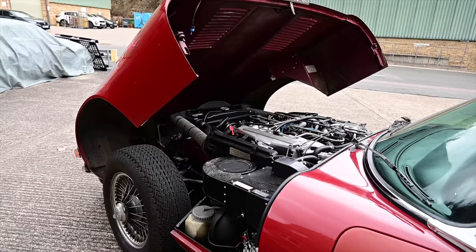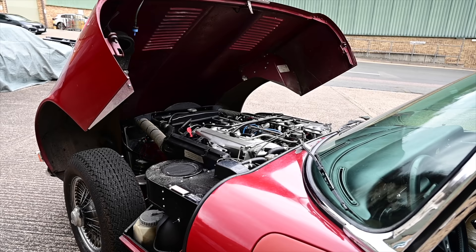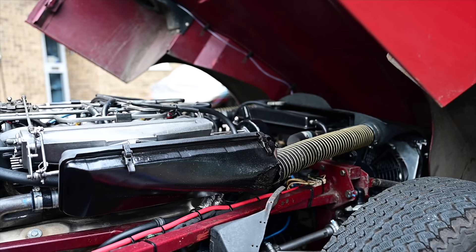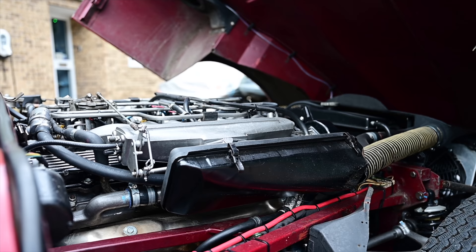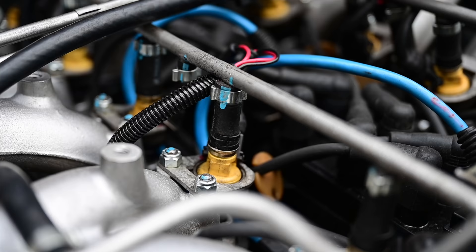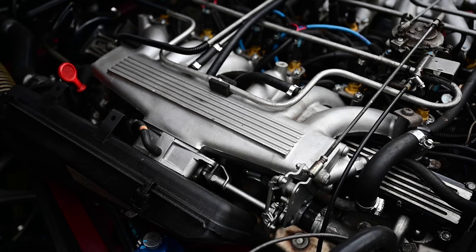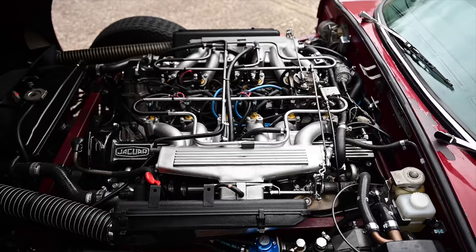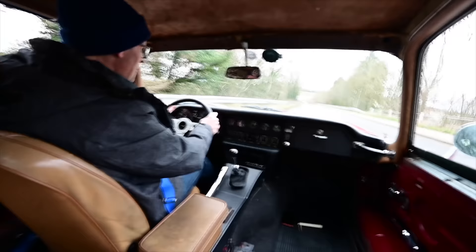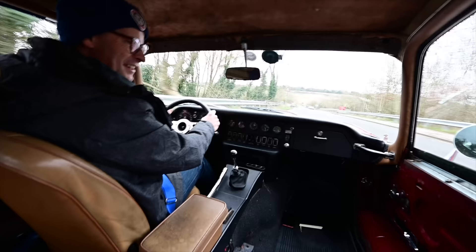Although this car does still have its original 5.3-litre V12 under the bonnet, it's been heavily worked over. Gone are the old carburettors. Instead, it's got a custom-made EFI setup running from a trigger wheel on the crank at the front of the engine. It uses XJS inlet manifolds — purely the manifold casting and nothing more other than the potentiometer with the throttle linkages. It's got custom-made high-flowing fuel injectors in all 12 cylinders, giving it the capacity to flow for a 7-litre V12. So at some point they may actually extend this research program into something else.